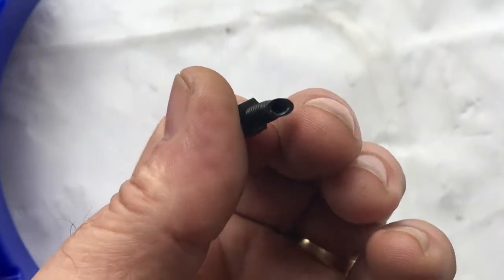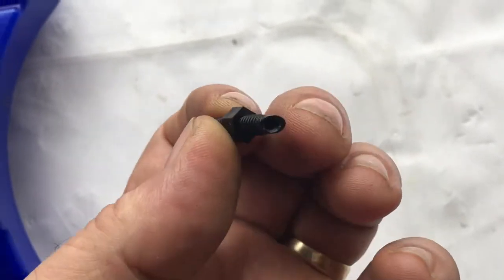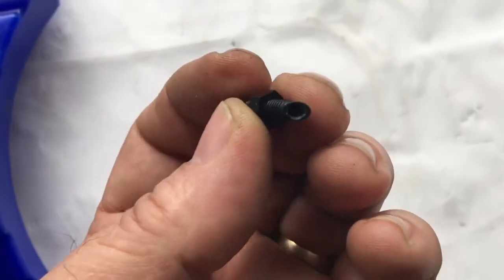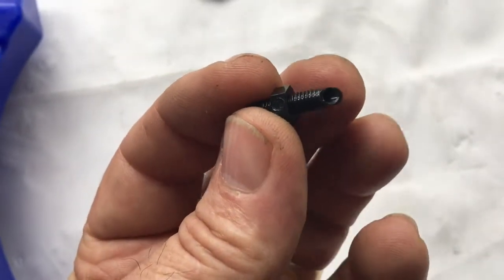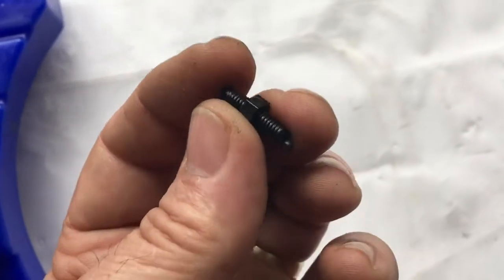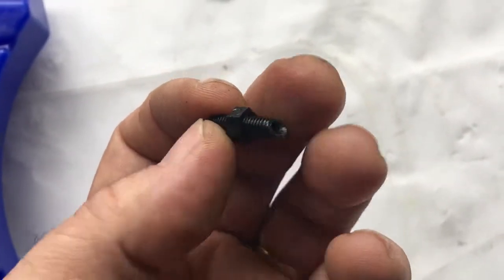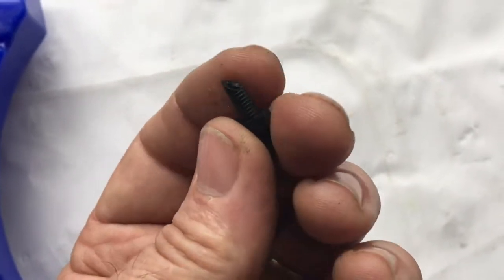Previously I've gone for big pickups and what I've found is all I've really done is make a rod for my own back, because when we're surfing in the surf with small granules of sand, stone, and shell, the bigger your pickup is the greater the chance you have of picking up debris, which is going to inevitably get stuck in either the ESC water cooling jacket or build up in your motor jacket.